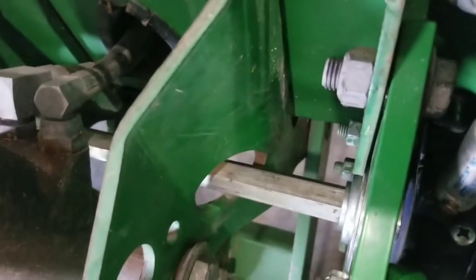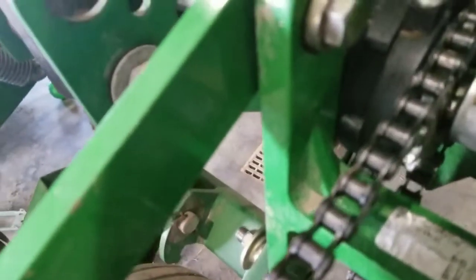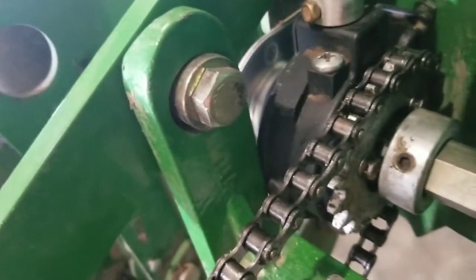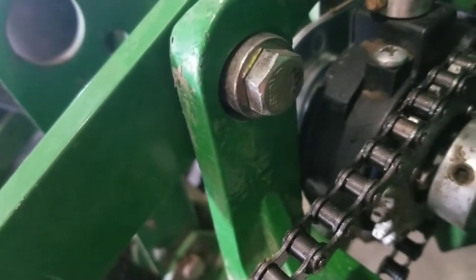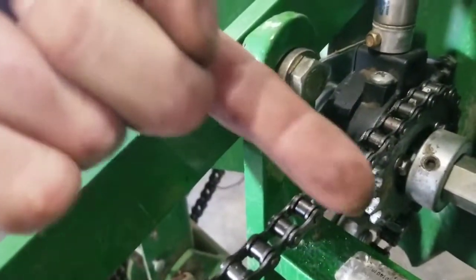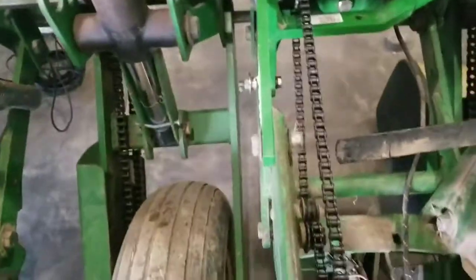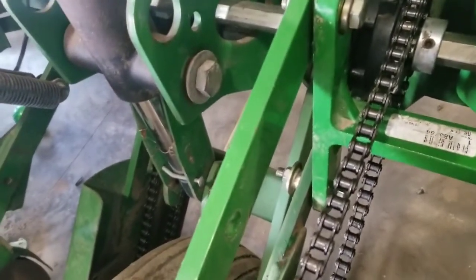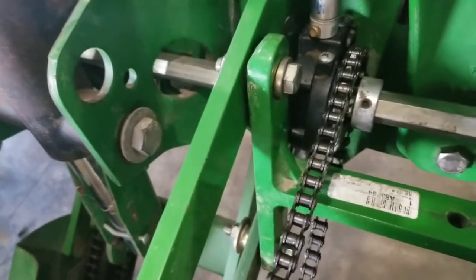This clutch only has one spacer between it and the hanger bearing, and it is dangerously close to this. I've picked the thing up and ran it up and down, and it'll never bother — I'm not worried about it making any contact with that clutch. This is as close as it'll ever get. But it's something I'm going to have to keep an eye on. It would be better if I had two spacers in there to get it out and away a little bit. If I run it a while and it looks like it's starting to get into that clutch housing, I might have to actually shim that clutch out another quarter inch, and that would get it clear of this bracket.